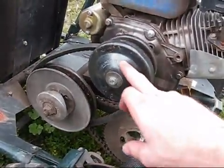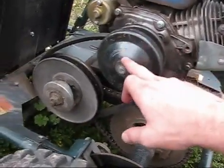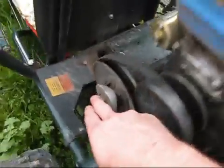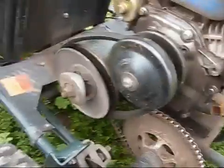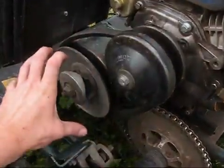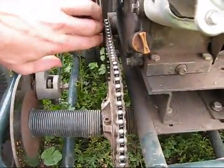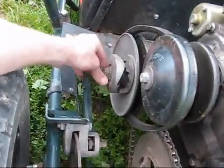The third type of setup is a torque converter, like what we have here. You have your driver, which is the part that goes on the engine, and then you have your driven that goes on a jack shaft. You can see how the jack shaft is set up going right through here — it's actually factory made. Once this engages, it will turn the sprocket on the jack shaft on the opposite side.